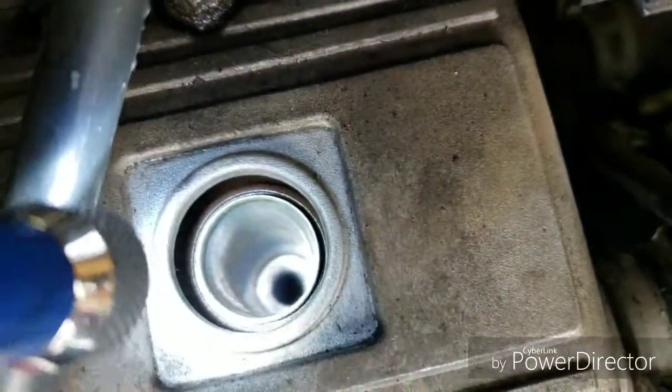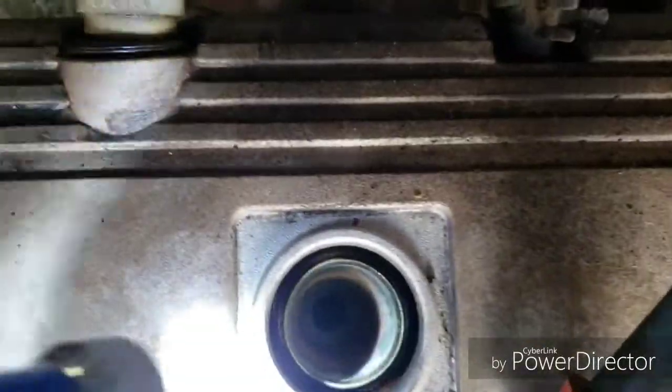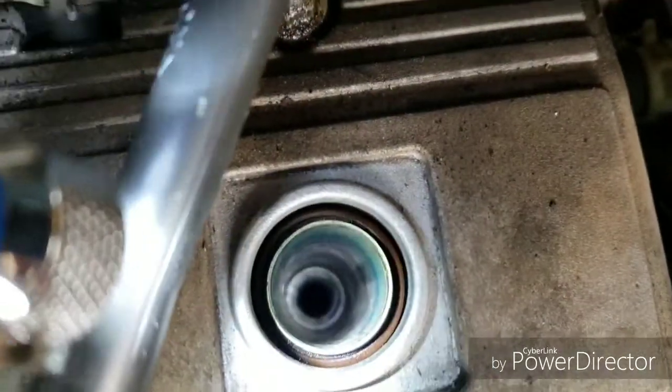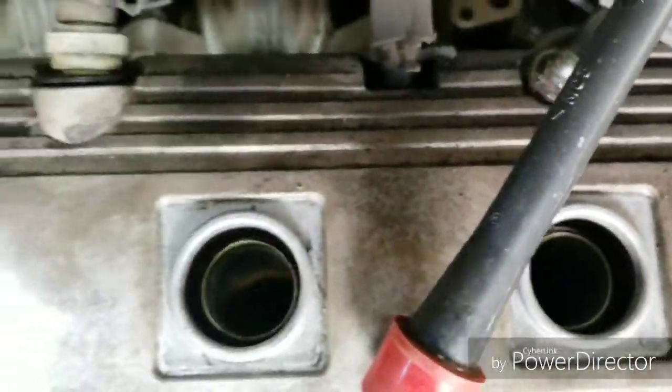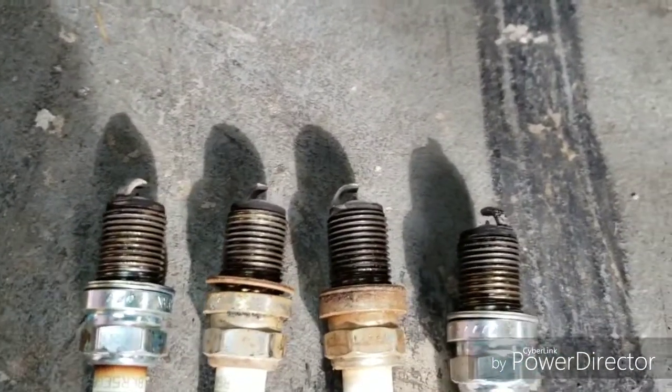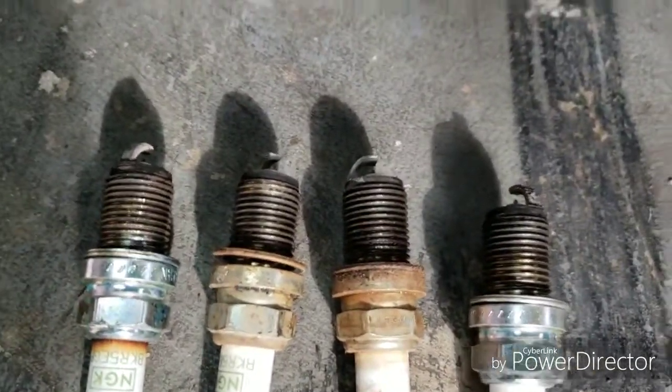This one is super dry. And so is this one. But this one looks dry and clean. Like these two have overheating marks, it looks like. Just like the spark plugs show. And this is the only decent looking one. All the cylinders are looking black. All the top of the pistons, I mean. Definitely black. Again, that's probably just normal for this age of vehicle and not being maintained probably like it should.